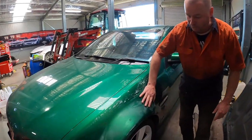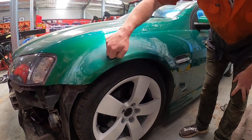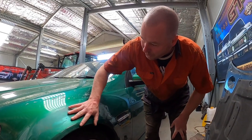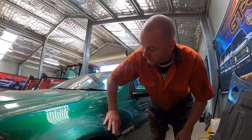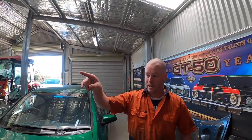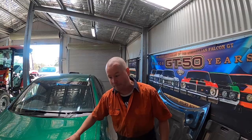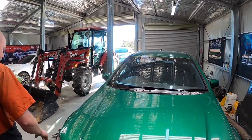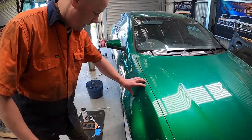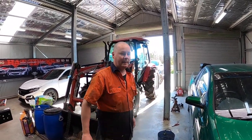I'm going to do the front guards as well. This car has been in an accident at the front and we could hear there's obviously some bog under there, and all the clear coat was starting to come through too. We're going to sand all that back — we've just started there. You've seen the front bar before. We've done that in a matte black but then I put some clear on. I'm not happy with that — I'm going to knock back the clear and go all matte black. Matte black bonnet, matte black bar. We're going to do the other guard and then we'll have the whole front end done in matte black.